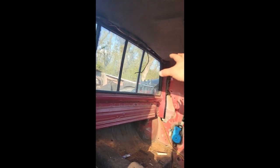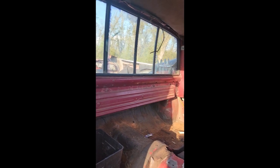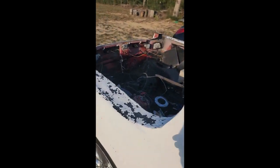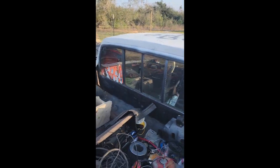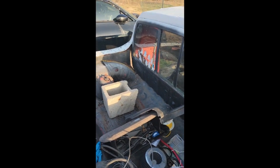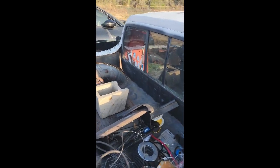There's this overhanging sheet metal that needs to be dealt with. I'm not sure why they'd squeeze the headliner back in without dealing with that lingering edge. I'm not here to criticize, I'm here to finish. It feels solid — it's hard to look at it and understand exactly what was done. Along the bottom it was welded a fair amount, but they're bubblegum turd welds — and I'm not above those myself, that's just how I'm describing it.